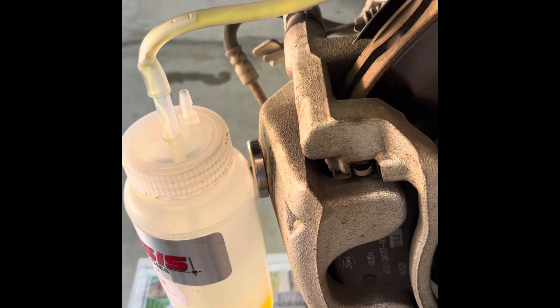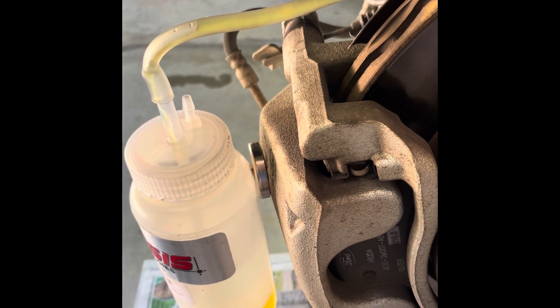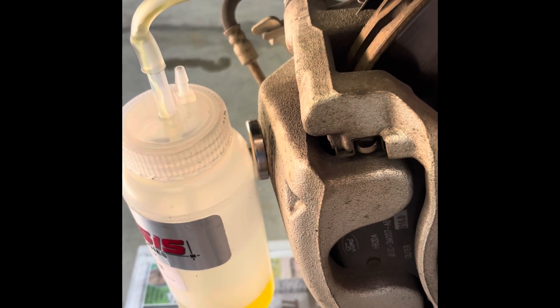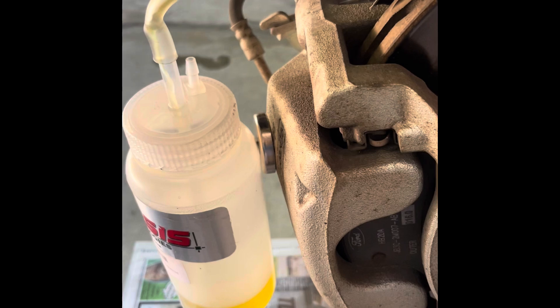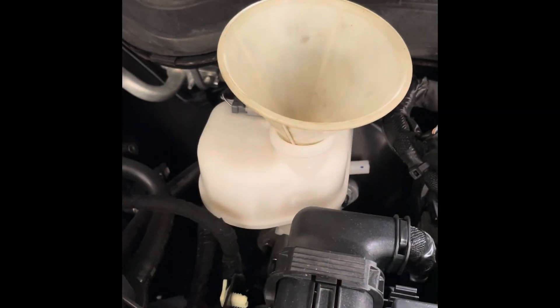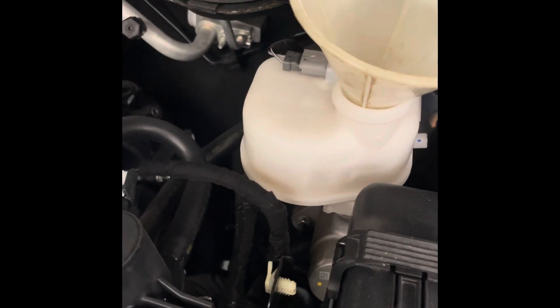I want to be sure that the hose goes clear down to the bottom and is covered with brake fluid, because we don't want to draw any air back into the brake system when we pump the brakes. The next step will be to pump the brakes and flush the fluid through until we start seeing clear fluid. We'll do that in cycles of three pumps, then refill the reservoir. Now we'll pump the brakes from inside — vehicle's turned off, all the way to the floor, depress, let it come back, all the way to the floor again, and a third time. Now we'll add a little more fluid to the reservoir.